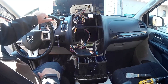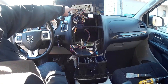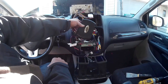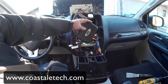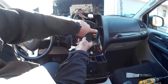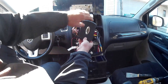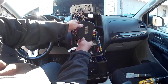I have my dash opened up so I can show you my setup. This is the MyGig radio and in the back here it has a gray connection and a white connection. What you do is you take this lockpick — I bought this from Coastal E-Tech. They have a whole bunch of new stuff. This is a couple of years old and what it does is it allows you to input video from the Apple TV. We're going to have to convert it from HDMI to RCA, and I'll show you that in a second. It also has an input for the old iPod 30-pin connection.